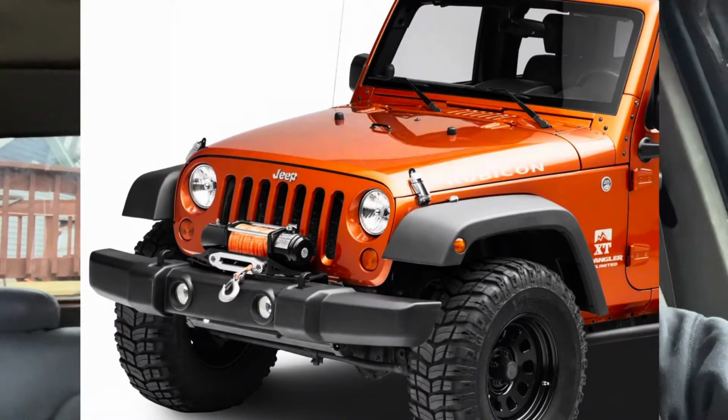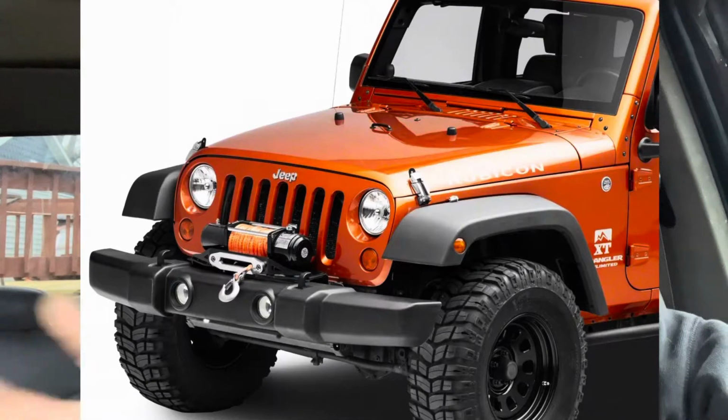Now, what I do see is it fluctuating that high right off the bat, and a lot of times there's a lot of stuff in front of the grille. People put grille inserts on there. They change the grille. I'm very traditional. I hate changing the grille on something, especially a Wrangler or a Cherokee. I keep my grills the same. I don't go with the aftermarket stuff. If you do that, that's perfectly fine. But a lot of those restrict air and it don't let it breathe and suck that fresh air in and cool that radiator down. A lot of people will buy a cheap winch bumper. They'll stick the winch on it. It'll be right over the radiator and the air actually deflects over it when you're driving down the road, especially on the highway, and it will overheat instantly. And that's not good.